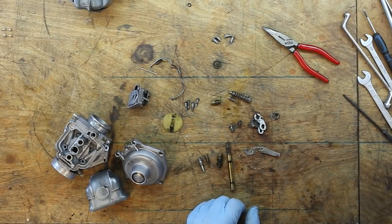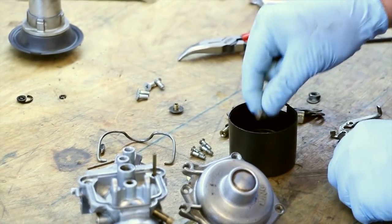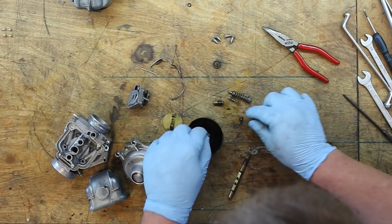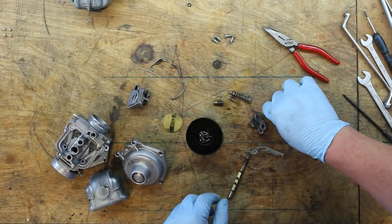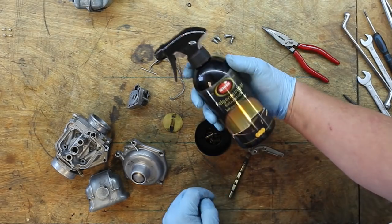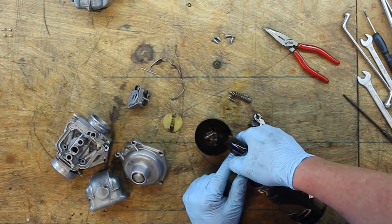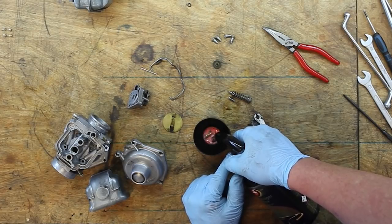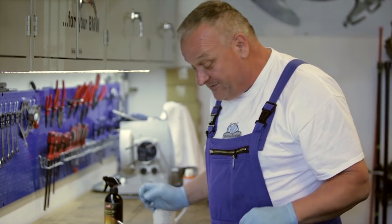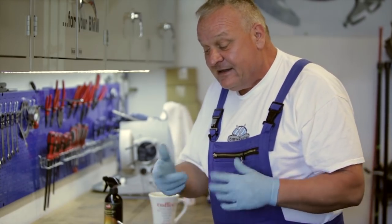Now for cleaning these little parts — I found a pretty neat way: simply take the cap of a spray can, throw the parts inside, put the screws and parts that you want to get the grime off in there. Then I take wheel cleaner — this is from Autosol, but any kind of wheel cleaner will work — let it soak for a little while. It has a mild acid, but nothing too strong that's going to wreck anything. You don't want to leave it in there for a long time, but five or ten minutes, then rinse it off with water and they come out looking pretty nice.